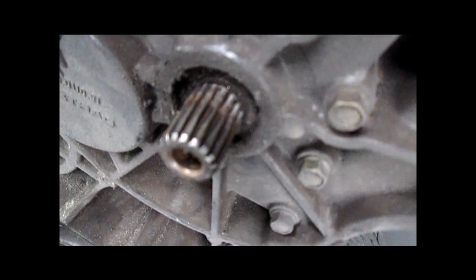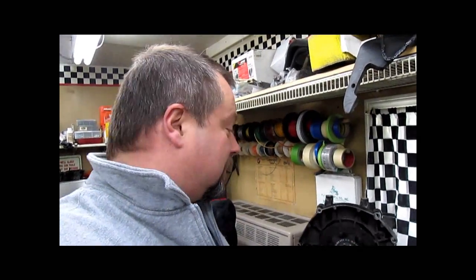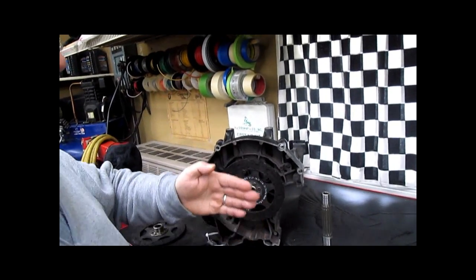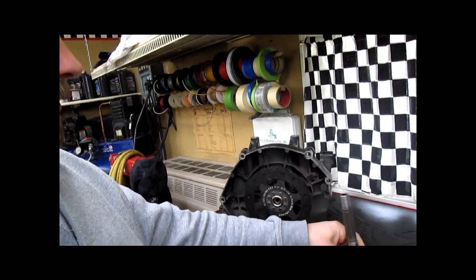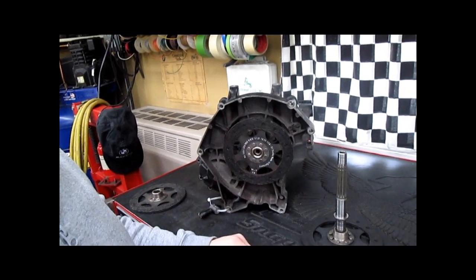The input shaft is also destroyed when you have a failure. What is the solution to cure this design defect? You could approach this in three different ways: change the whole flywheel clutch carrier assembly so it moves the clutch disc back further; make a longer input shaft with a longer splined portion to bring the splines out flush; or modify the clutch disc itself.